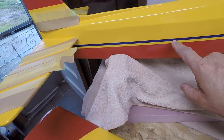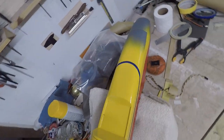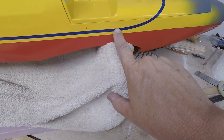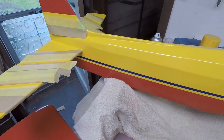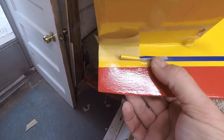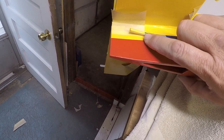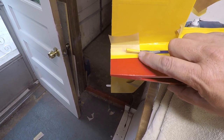It's very tedious and very mind-numbing — it's all got to do with taping for the stripes. This is some 3M automotive masking tape just so that you can go around curves. I had to come in and make this curve, and then it comes down along the side to where it's going to be the quarter inch gap. This one's already set in place. All I've got to do is put the tape on the bottom and the tape on the top to spray this section up on the nose, all the way back to the tail. This is going to be the blue stripe on the side that goes up over the top.